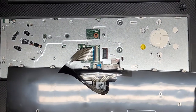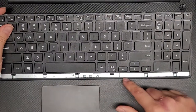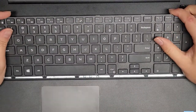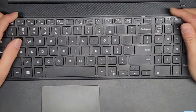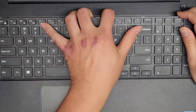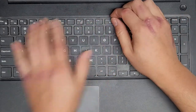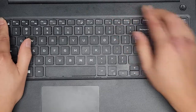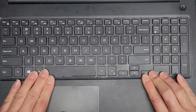We've got all the screws in. Let's go ahead and get the keyboard back in — flip it over and just like the opposite of before, slide this part in first, make sure all the little legs go under. Pull the middle up and work your way along the sides first. Once you've got that clicked in, go along the top and click everything in.